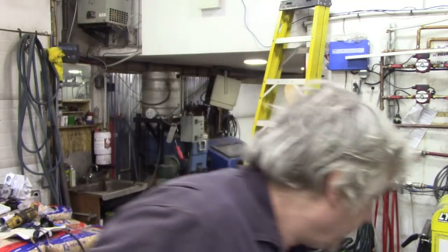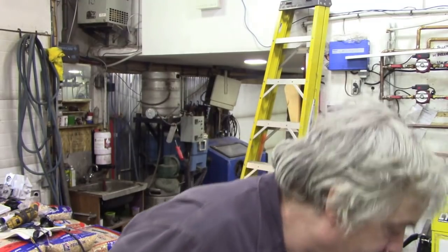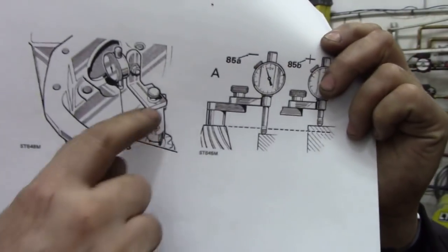But I have an axle. I have a Salisbury axle on top of one of the containers outside. Unfortunately, it's a bit too difficult to get to. But in springtime, when all this snow's gone, what I intend to do is get that axle, strip it down, sandblast it, paint it, and we're going to put it on the bench, and we're going to set it up by the book. We're not going to use a mag mount, because for the simple reason, we can just hold the tool here. We can use your finger just to push it down to measure the settings. Oh, God, I've got papers everywhere. Oh, this is a better picture. So we can use your finger to push down here to measure the settings, if you see what I mean. And we'll do it like that.